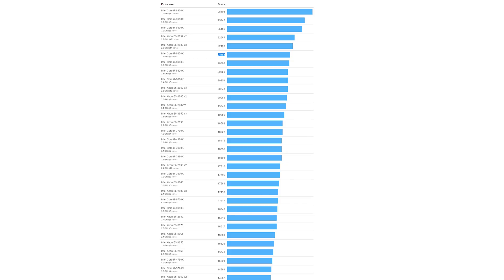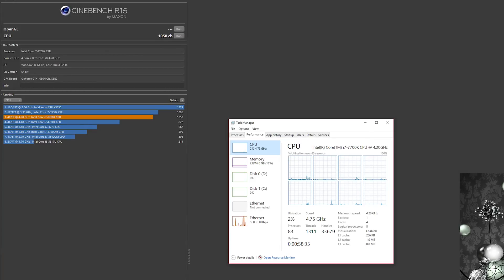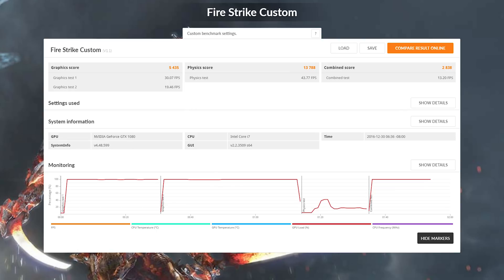This motherboard looks like it'll overclock decently well out of the box. Single-core performance on this chip is around the 6800K, maybe a little better. Our Geekbench score was almost comparable to the 6850K, which is the X99 platform — more expensive overall. We ran it through several benchmarks: 3DMark Time Spy, Cinebench, Fire Strike — which is partly GPU-bound but includes a physics test — and the CPU-Z benchmark. All results are being linked in the description. Good RAM and a decent GPU help complete the picture.